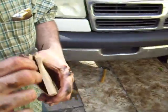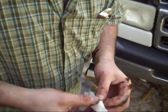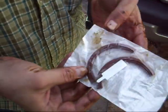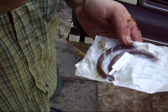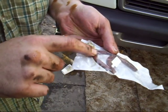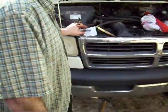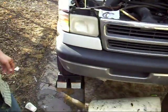On this van, like we stated in the earlier video, we got the two-piece seal. It's got an upper and a lower. This right here, that little plastic piece, goes in the top bearing so that when you slide this in, it doesn't cut up the outside because you'll have leaks. So don't think it's just an extra part. We'll get this cleaned up and try to get some videos and get it put back together if everything doesn't blow away.